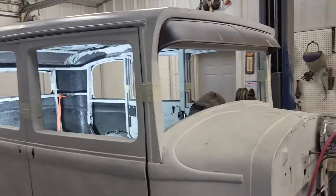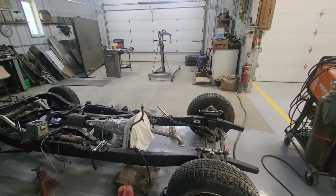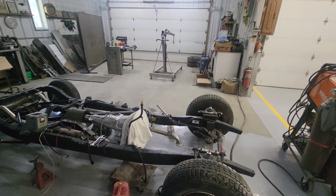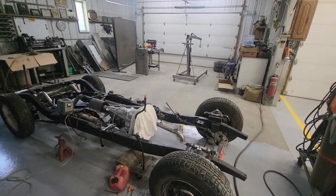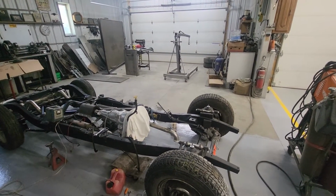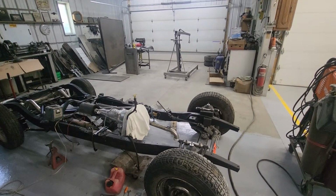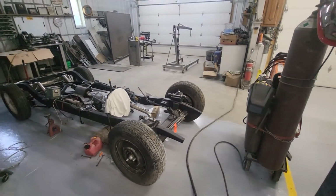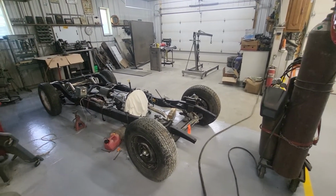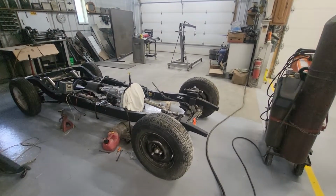Hey guys. So today's the opportunity. I went up to the machine shop and they had to get rod bolts. I told them the big block rod bolts for the cross. They purchased big block rod bolts, but the threads were about 40 thou. The rod bolts will work, but the threads ended about 40 thousandths beyond the rod cap. So they had to order washers. International used a 60 thou washer. And so they ordered those, and that has been the delay.